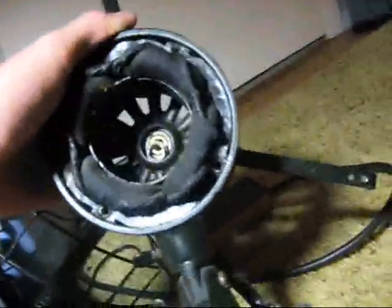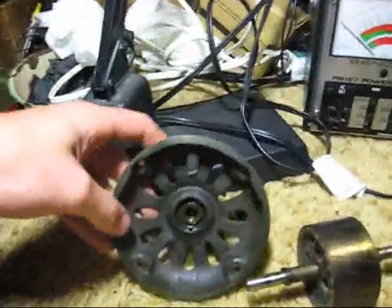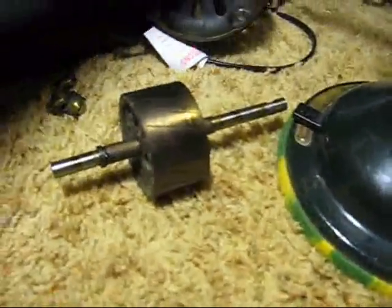Just take those oil cups right off. Here, in fact, I'm going to take the shaft right out. There it is. There's this bearing, look. That one looks good too. And I make sure to clean the oil holes there and everything. But my note is take the wicks out, because otherwise they will interfere with you putting the shaft back in and ruining your wick. Now this is cast iron too, this end housing.